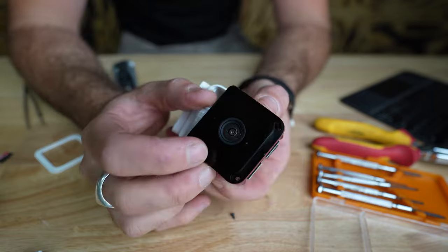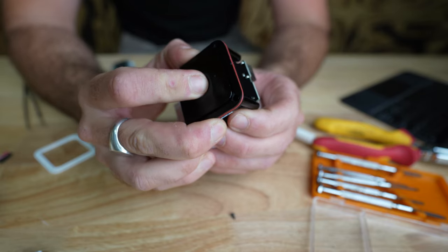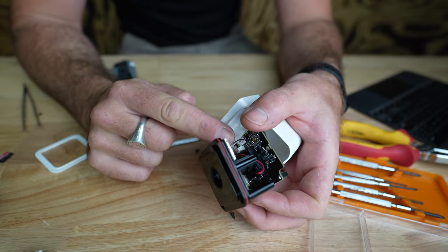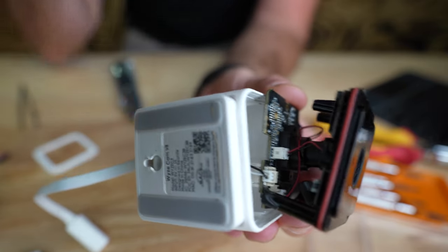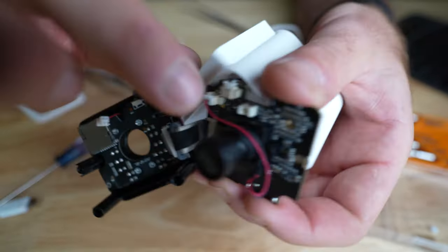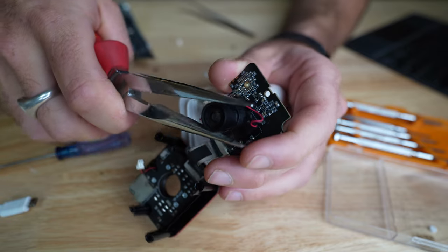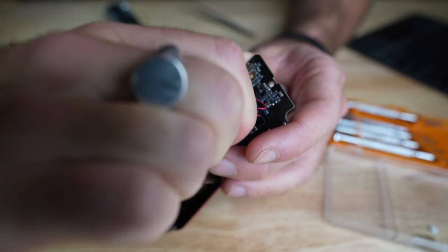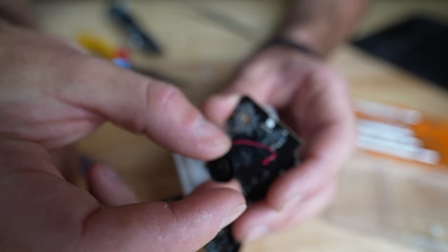It will be tight because the lens is actually holding it in place — it will be sealed. If you like, you can just push the lens and the face will come away. There's going to be a short cable just here and we're going to remove that to make it easier to adjust the lens. There is glue on the side of this lens as well, but we should be able to get it moving. That lens is now moving and we can adjust it to whatever focal length we like.